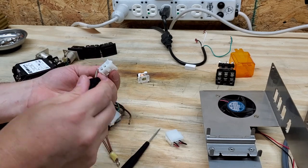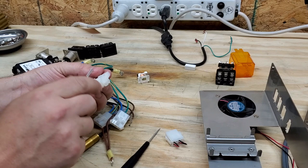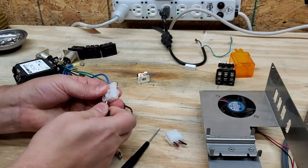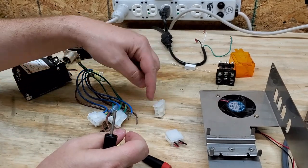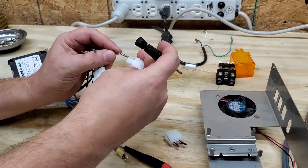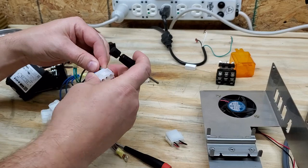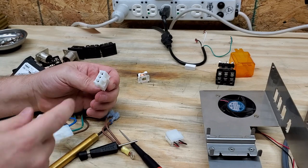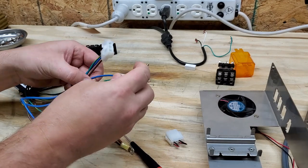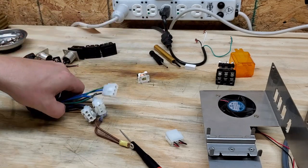So they fit together like so. Put the depinning tool over it, depress on the bottom, and it kicks out the wire. So we can repair Molex connectors — you do not need to change out the whole entire wire harness. You can just get a depinning tool, get the correct one, eject the pins, change out the nylon Molex connector. And of course take photos before you remove any wires, guys — always take photos before you remove wires. Then just insert them back in the exact way that you found them — you can hear it click. So those are called Molex connectors.